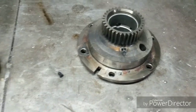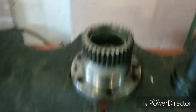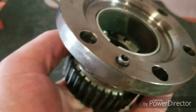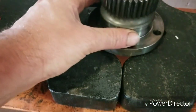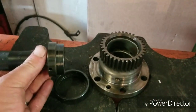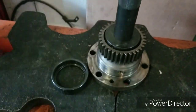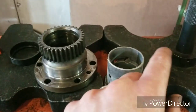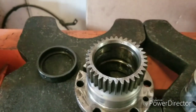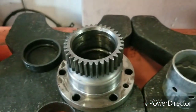Using a basic Harbor Freight press, we've got the bearing set up so it'll fall out through the hole. Make sure you're not pressing on that alignment pin. I'm going to use a factory Mazda press tool — that ring will be for reinstallation, we're just using it to press our bearing out. Our bearing is out, no issues — came right out using the simple Harbor Freight press and Mazda press tool.